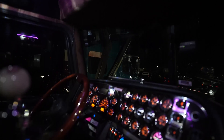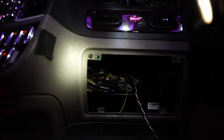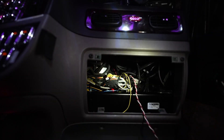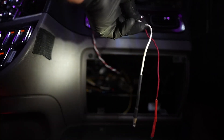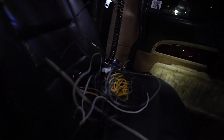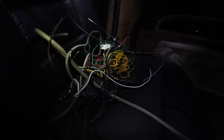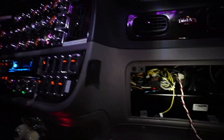Alright, so I finished the driver's side. Actually, Peterbilt has its own harness for the turn signals for the mirror and for the marker light for the mirror as well. So I made my little jump harness — this is going to be my turn signal, this is going to be my marker light. Pretty simple. And believe it or not, this whole rat nest was inside the dash, so I removed that. That's all factory stuff — the mirror harness, heating, everything, remote mirrors. So I got it out, cleaned it up a whole lot, it's all clean now.